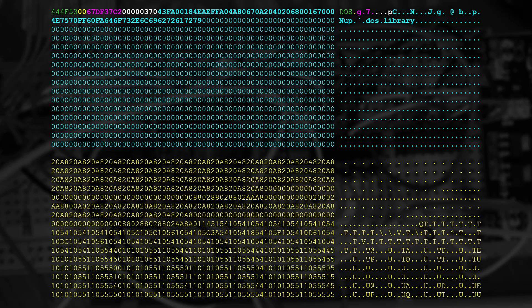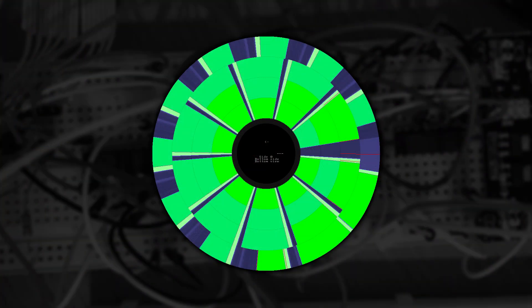However, this time there's something else hidden inside. But why store the Atari ST FAT12 sector inside of the Amiga sector? Well, there are two reasons for this, although the first is less of an issue with the ST than it would have been if this was being used on a PC, but it's still valid. Looking at just the first 4 tracks - remember that the inner tracks all have sectors that are 512 bytes in size, whereas track 0 has them at 256 bytes. Following the pattern around the edge, the first sector, shown in pink, should really be around here, which is smack bang in the middle of the Amiga's second sector. Timing can be important, but also all these FAT12 sectors needed to exist for the file system to actually work. And if they hadn't been 256 bytes in size then there wouldn't have been space for them plus the two Amiga sectors. A very sneaky place to put that extra sector inside space that would normally not be used.